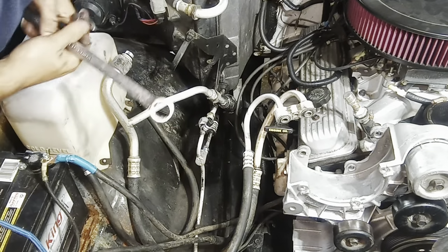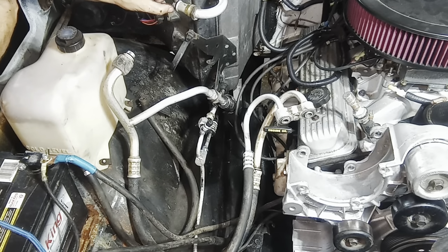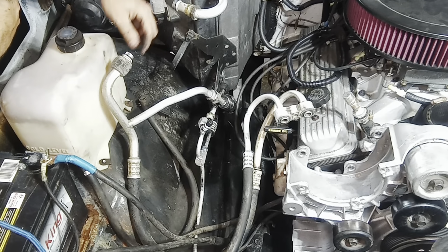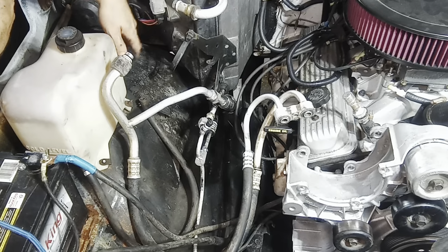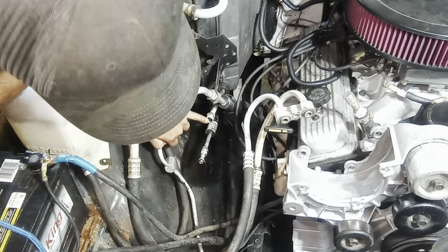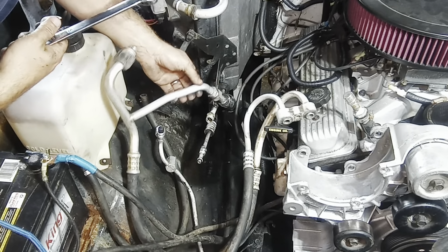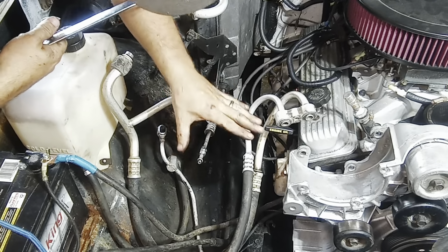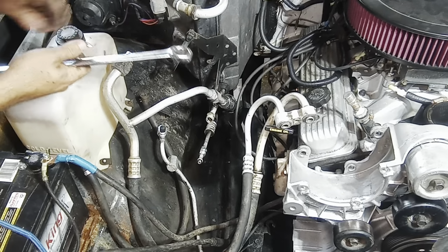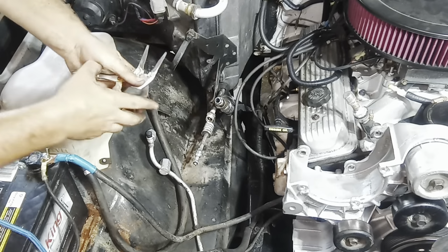I'm trying to keep, if you could see, all the O-rings on these because I got the new green ones they say you have to use. I'm trying to keep them all on so when I go to replace it with the new parts, I can switch them over as needed so I can try to match up the size. And so the orifice tube is in there, so I'm going to try to get that out. But I think I'm going to go ahead and get this other line broke loose first, and then we can get this whole piece out. And like I said, tomorrow I can get some flush and flush out all these lines before I put it on the new. All right, y'all. I'm going to try to get this orifice tube out. Let's see.